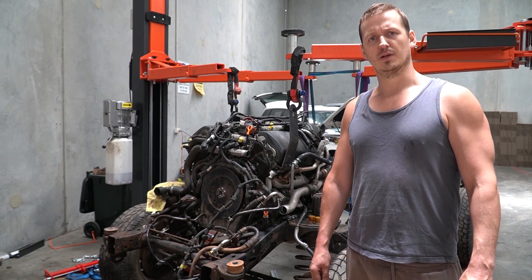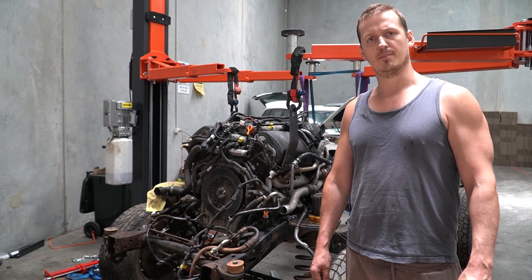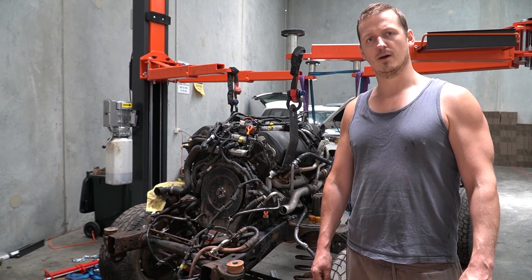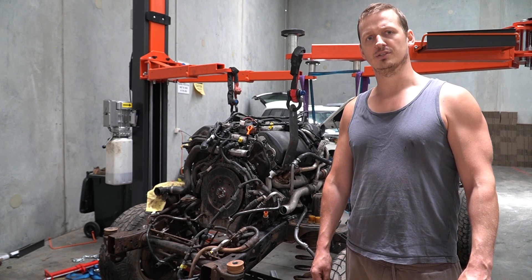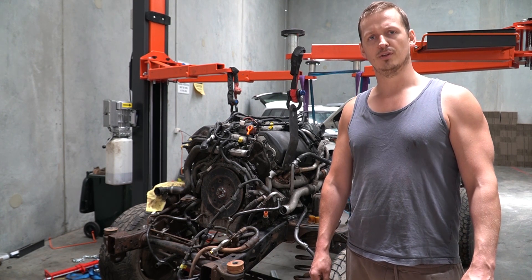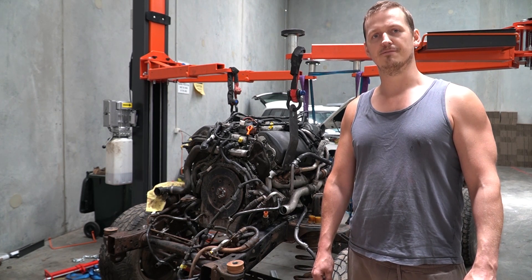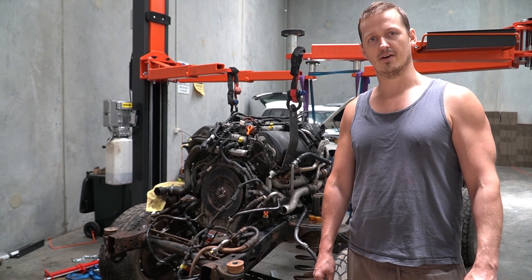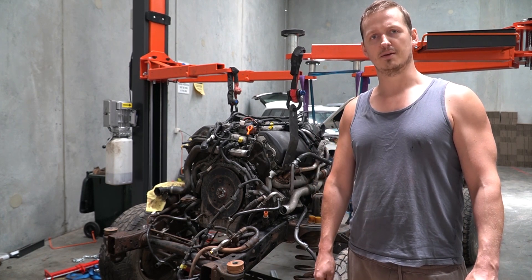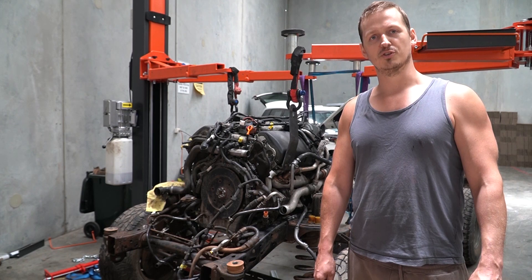What are the consequences of not listening to engineers when making engine mounts? You're going to get a lot of driveline vibrations and engine vibrations. If you've watched the Skid Factory building their Nissan Patrol with a Cummins engine, they got a lot of vibrations — a lot of which could have been mitigated using this guideline. I'm not shitting on Skid Factory; I think they make amazing things. I'm just saying that's a possible improvement they could have made.